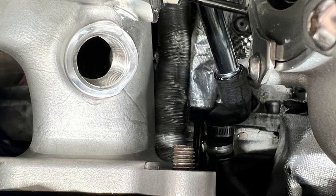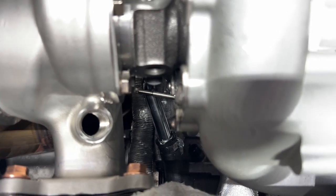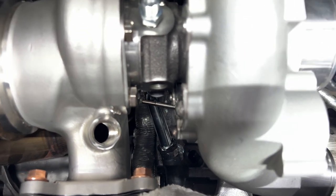That was kind of a pain - honestly, this was probably the most challenging part of the whole install, other than fixing the leak we'll talk about in the next video. The pipe was pointed in an awkward direction and was a little bit longer than it needed to be, which made it hard to get married up to the hose on the block side. So I bent that pipe a little bit using a small pry bar, keeping in mind I don't want to hit the wastegate actuator. I also cut a little piece of the hose off to make it shorter. You can see what I ended up with was a fairly straight shot from the oil return down into the block.